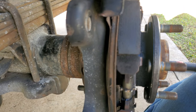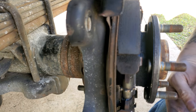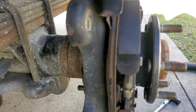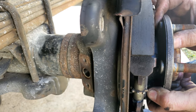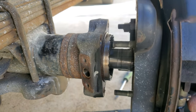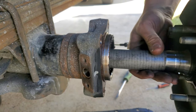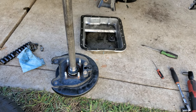I like to keep all my stuff side-specific — if it came off the driver's side I like to put it back on the driver's side. Let me grab a pan to put underneath this because there's going to be some fluid — be ready to catch some of the diff fluid that's going to come out. As you can see it's already moving. Let's see if we can pull her out — there's your axle assembly.